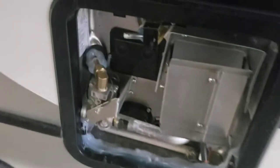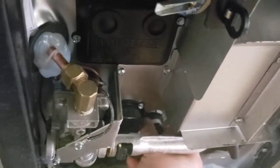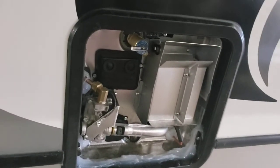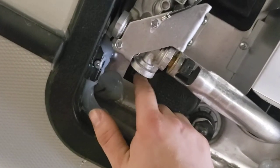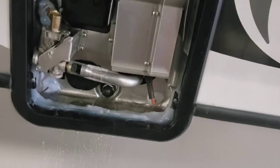This is your door for your water heater — it turns and pops off. The water heater is very easy to use. When you're ready for the season, de-winterize it, get all the antifreeze out, then put the plug in and tighten it — it's an inch and a sixteenth socket size. Snug it down but don't over-tighten it. Then when you take it out of bypass, just start filling with water. Once it's full, you can turn it on. All your controls are from the inside on the touchscreen except for one: there's a switch for electric on the outside. It's off right now — you can turn it on from inside but it still won't work unless that outside switch is on. As a safety feature, I like turning it off just in case. So if you turned it on from your in-command and you're wondering why you don't have electric heat, make sure you come out here and turn that switch on.